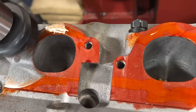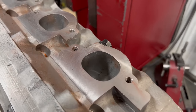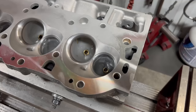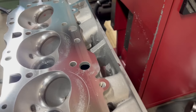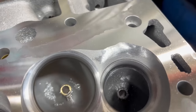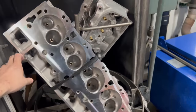I opted to resurface the exhaust manifold side of the heads because they looked a little rough — here's some slow-mo cutting action of the fly cutter I use on the exhaust side; definitely keep your fingers away from this. Moving on to resurfacing the heads themselves, we're running a PCD cutter on the RMC 1000 surfacer and the goal is to take as little material as possible to get the heads flat again. They were warped a little bit and had some funny wear, possibly from pistons that had hit in the past. Around four thousandths in we still had wear marks between the cylinders, so we took additional cuts. One chamber had a little bit of damage so I touched it up with the cartridge roll before the final cut, and I put some Tap Magic across there for a nice surface finish. Both heads took around six to eight thousandths total.